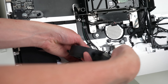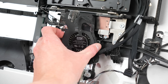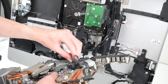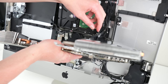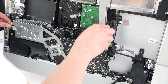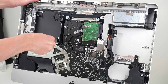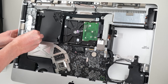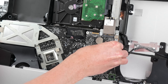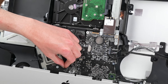Two of the three fans will need to be put back into place before I can install the logic board. The lower left fan has a few cables that clip onto it, so it's important that they're properly cable managed before it's screwed into place. Now I can install the logic board. It's a bit difficult to connect the cables that attach to the rear, as they're quite short. However, once they're attached, the board can be positioned back into place. Be sure not to trap any cables below the board, as they could get damaged if they get jammed in the wrong place. I am very tempted to pick up a 2019 iMac and completely spec it out — put a large SSD in it, max out the RAM and CPU. It would be costly and a bit more nerve-wracking as the display is glued in place, but once it's open, it wouldn't be any harder than this one.